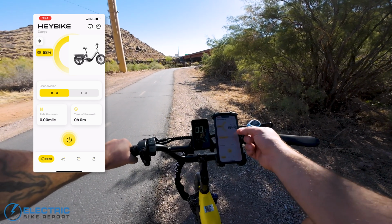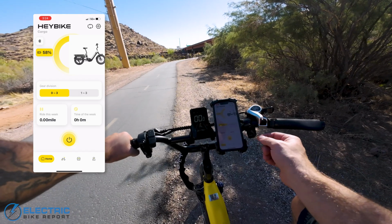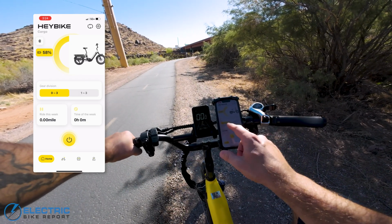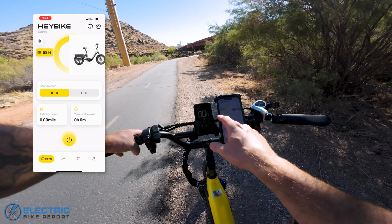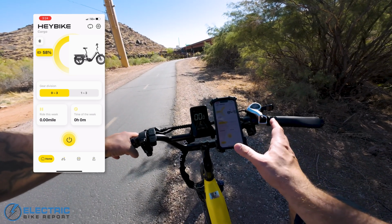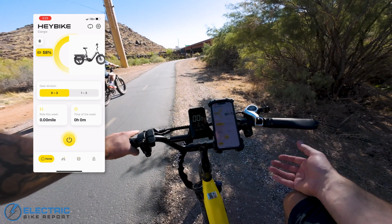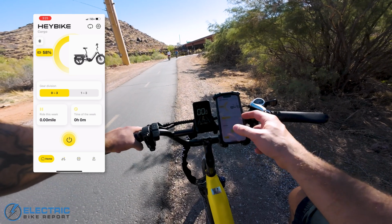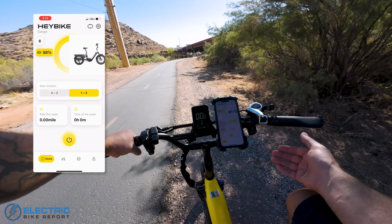The first thing to see below that, interestingly, before I connected the app, the bike had 5 pedal assist settings, and now once I have it paired, we're looking at 3 essentially. But this first thing that they're calling gear division gives you the option to basically have one additional 0 power setting where there is no pedal assist. So if you choose this one that's just 1 to 3, whenever you turn the bike on, it will automatically be in that lowest setting.